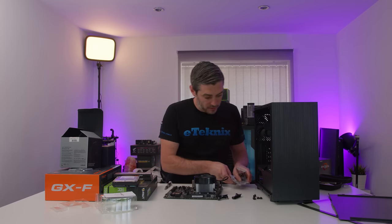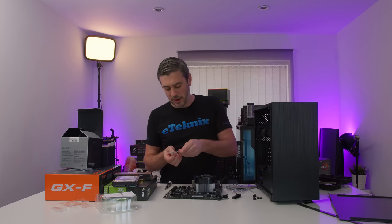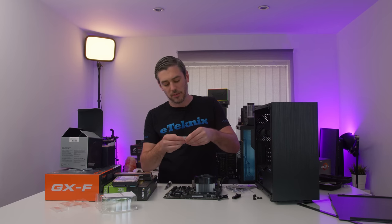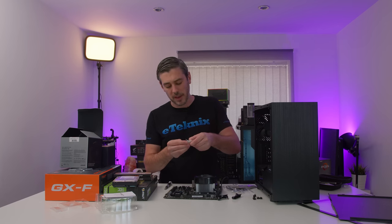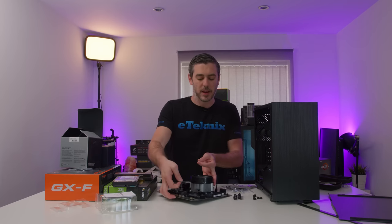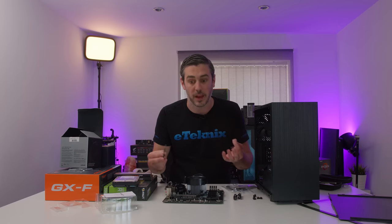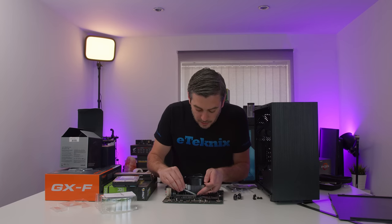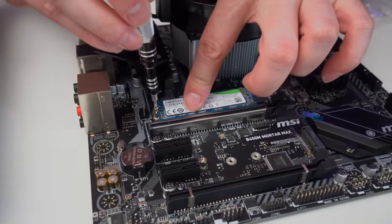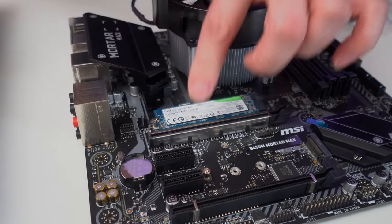We have the M.2 drive and the 4TB drive. We need our little screw for the M.2 and then we can put that directly onto the motherboard. We're only going to need one SATA cable for the hard drive. At the moment the price parity between M.2 and 2.5-inch isn't much in it, so you might as well just go for M.2 and save on cable mess. Put the drive in, get the screw at the ready, plunk it down, and screw it into place.